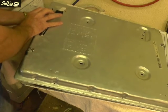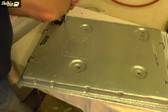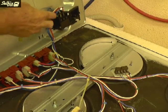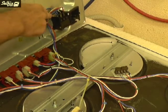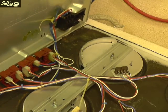Before you replace the base cover, first refit the junction box and be sure to reconnect the earth terminal to it. Another thing to watch out for is that the wires on and around the junction box are at the side of it rather than under it, because this would prevent the cover from sitting properly.